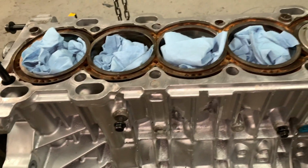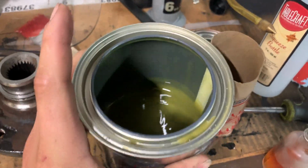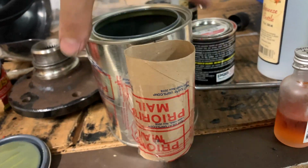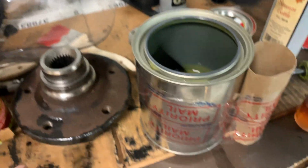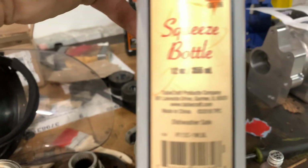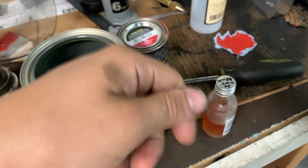So we're gonna level this thing and we're ready to fill. Here's what the epoxy looks like. This is the resin. You can see this container is really only about a quarter full. This is 1 quart. I think 1 quart's pretty close to a liter. So we'll probably have about 250 milliliters or so to work with, which will be plenty because this is 355 milliliters. So what we're gonna do is mix the hardener inside of here in small amounts.